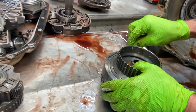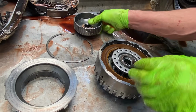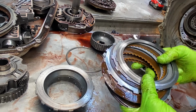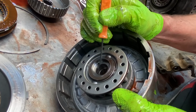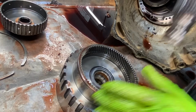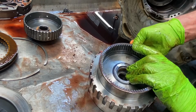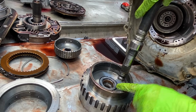We have our forward drum here. Forward clutches are actually pretty thin. Hardly nothing on them at all. They're not fried, but there's just nothing there. So you want to look down through here too, like I was telling you, where that shaft can rub, where them two seals run on this shaft right here, because it sets down in there like that. So both sides. This side you want to look here. That looks good. Just take some Scotch-Brite, clean it up really nice. Always put a new bushing in here because this bushing here is what keeps this shaft from touching.